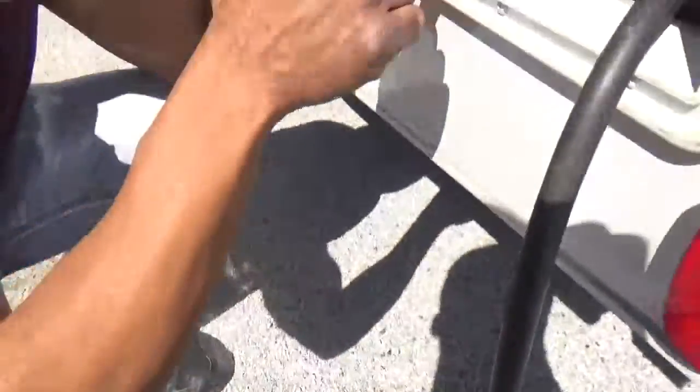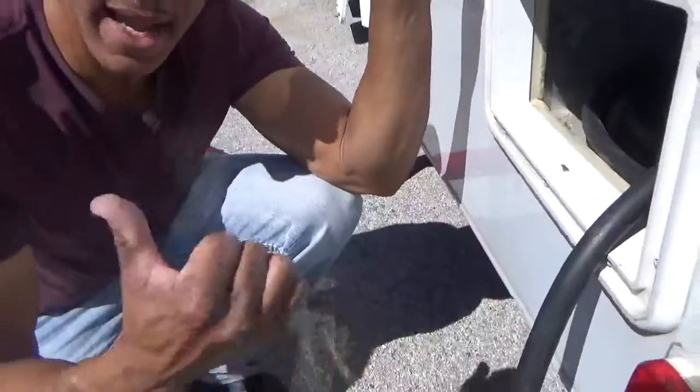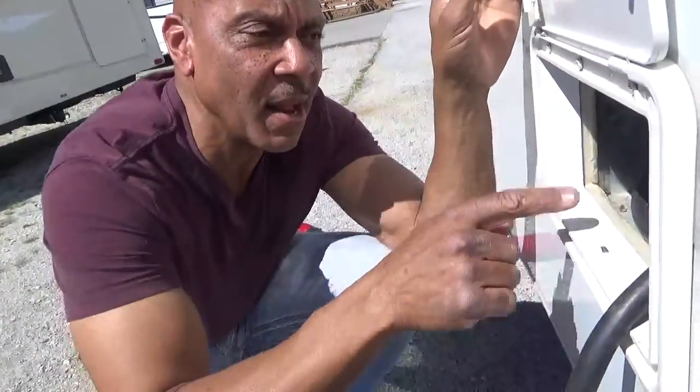With this motorhome, when you're about to depart, you unplug this cord from your 30-amp plug. Inside this compartment you see a big metal box — this cord must stay plugged into something at all times. You're either going to have it plugged into that box or at the campground. When you plug this back into that box and start up the generator, the generator sends all the power to that box, and then it gets inside the coach. If your cord is not plugged into that box, you are never going to get any electricity inside the RV, even with the generator running.